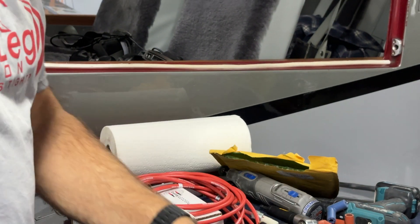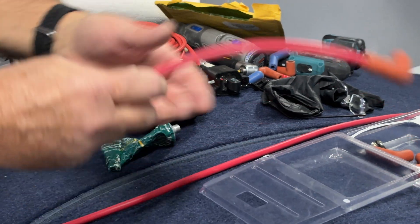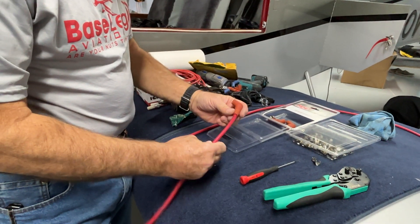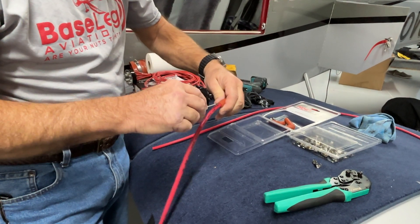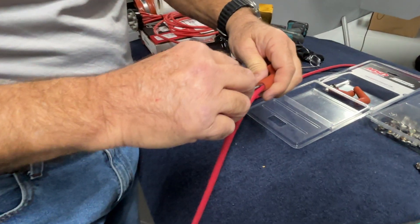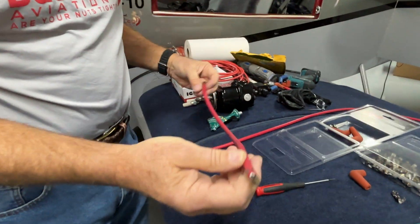Okay, let's go over here and show you how we make the spark plug wires — it's very simple. I actually buy this stuff in bulk because we do so much of it, but you can get the wires pre-made from Lightspeed. The first thing to do is pull the old wire off to figure out the length you need. These rubber caps seem to last well; I'll just use a little screwdriver to go around the inside and free it from the spark plug wire, then grab it firmly and pull it right out.